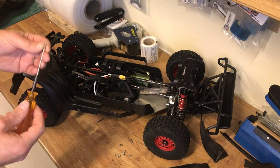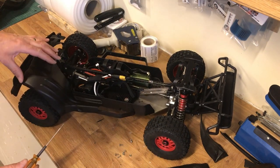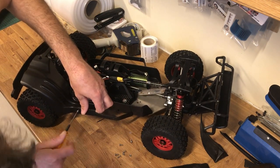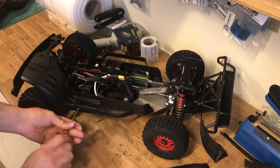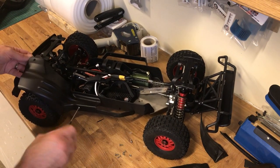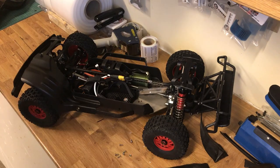There we go. Always use MIP, definitely the best tools. So just hang it on the front body mount, look through the little hole there until it lines up with the air bar. Screw it in. Feel for it to nip up.